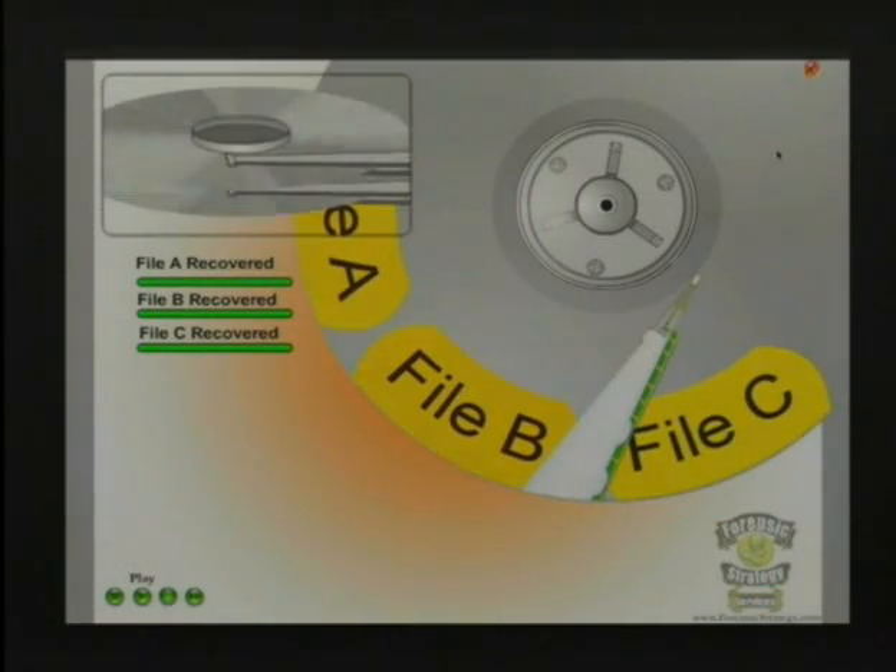And coincidentally, if you're doing a RAID, you have to do this — there's no other option. There is no OS. You've got one bad drive in a set of drives, and you're going to have to image that drive. You'll probably have to image the rest of the drives that are good to try to reassemble them with software. There are pieces of software that can reassemble RAID and try to guess and work things out. For the most part, I'm trying to address the physical problems of a drive regardless of the OS.